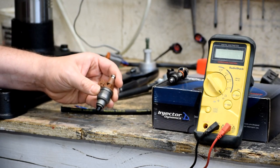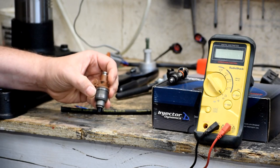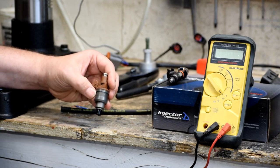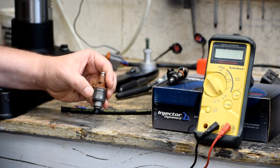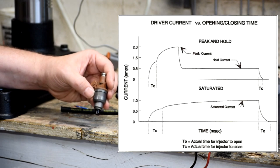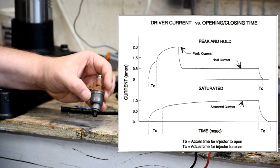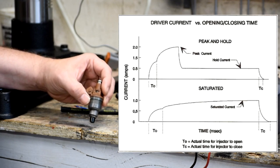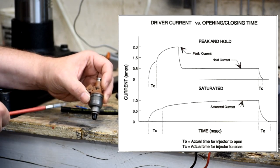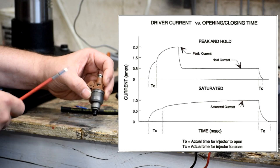What we've got here is what's called a low impedance injector — low impedance because the resistance of the coil inside is low compared to a high impedance injector. The difference is really about the control strategy. There were two strategies: the basic one, called a saturated or high impedance injector, is a simple on-off circuit — computer pulls to ground, solenoid comes on, fuel squirts in. But high impedance injectors of the time were not particularly responsive — slow to open, slow to close. That's okay in an economy car with a small injector, where the fuel flow per millisecond isn't that large.